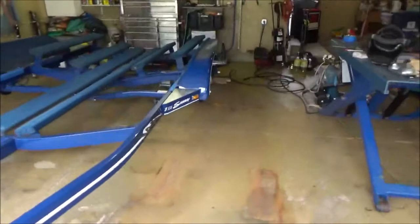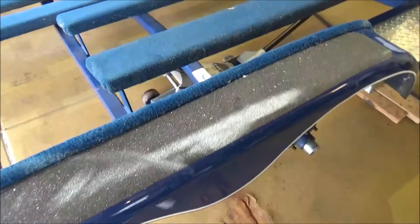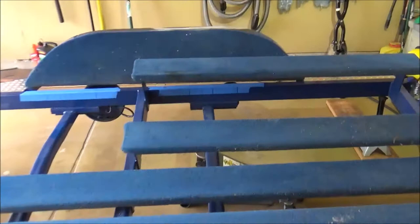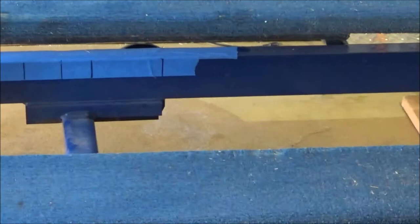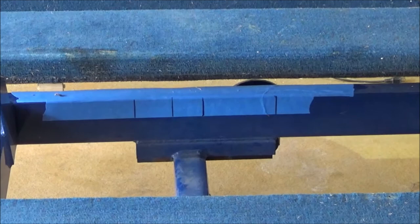We're going to go for the idler axle first. To show you what I've done, I have marked with tape and then marker where the axle lines up today. That measurement doesn't have to be precise. That's roughly the 60-40 split of the trailer. That's why that's important.